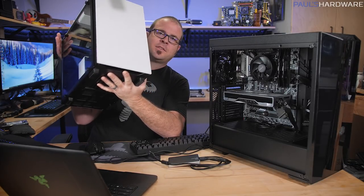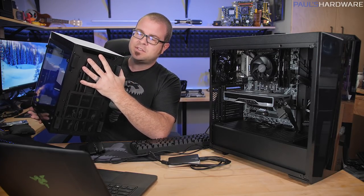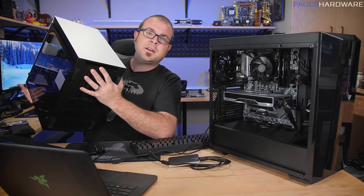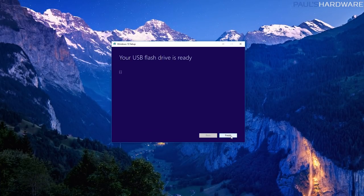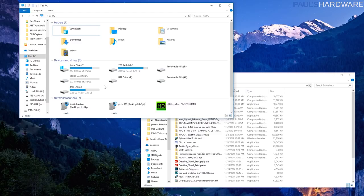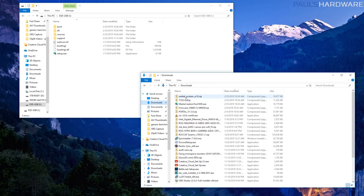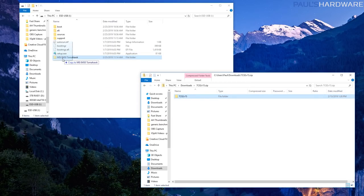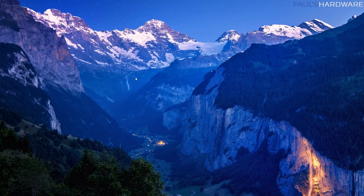If anyone is concerned that I'm not doing the installation on the Intel build I put together — it is pretty much exactly the same. The only difference is that the motherboard manufacturer's website is going to be for the Intel motherboard rather than the AMD board. Other than that, you need the same drivers and software for both systems. The USB flash drive is ready — we can hit Finish. Before we jump over to the new PC though, I'm going to go into that USB drive and copy the BIOS and LAN driver files I downloaded from the motherboard manufacturer's website into a new folder, so I know what is what. Now we can switch over to the new PC.